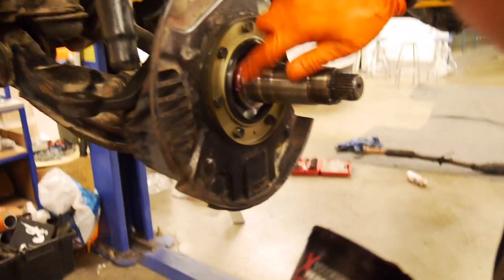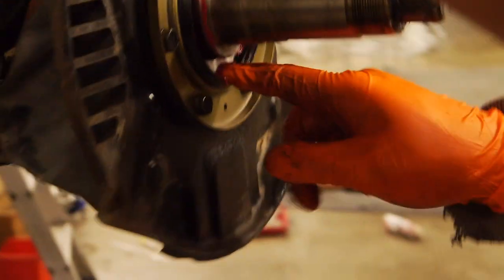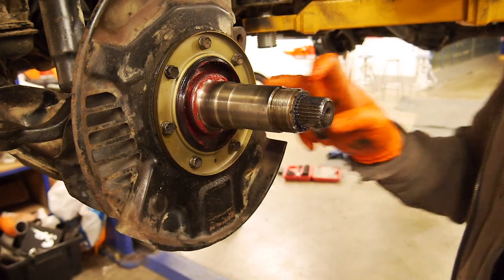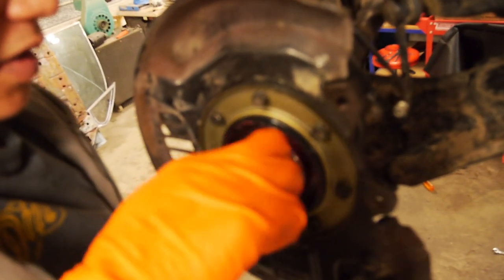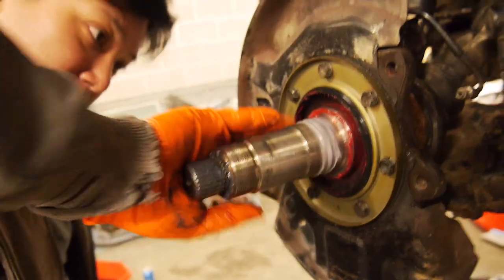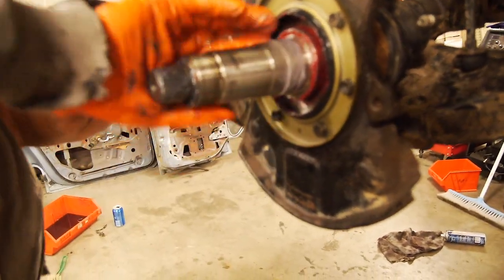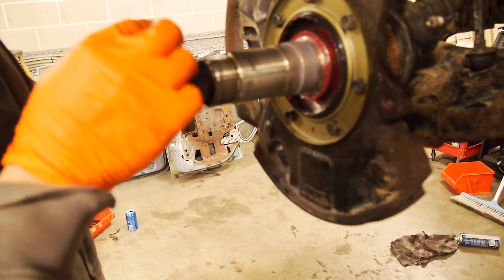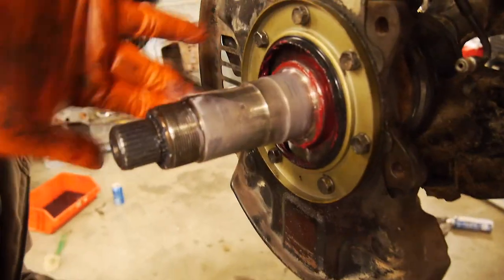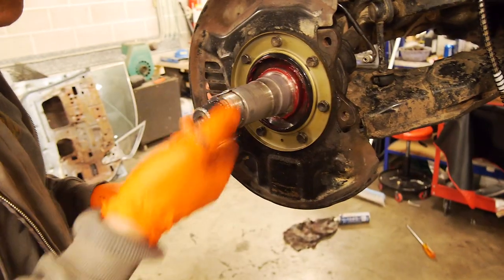Next step is to put the backing plate — fit that up so it goes like that. There's the space for the two caliper bolts. Here's the oil seal or sealing ring — the holes aren't drilled equally so that the ring only fits one way, with a little hole to the bottom. What is that little hole for? I've no idea — it looks just like an indexing hole. So what I normally do is put all of them in first loose and that will help to align everything. Then I'm going to put lithium grease on all the areas where the seals run — inside there — making sure it's actually between the two rubber lips of the seal. Then the two bearing seats — this is just anti-fretting paste.